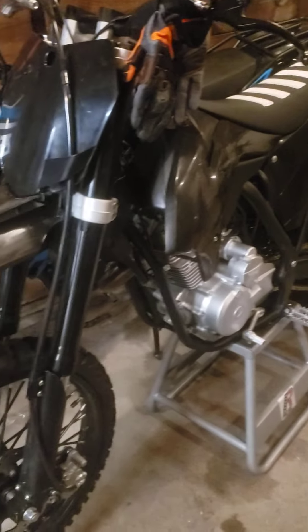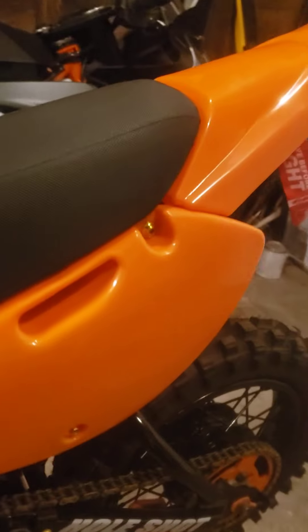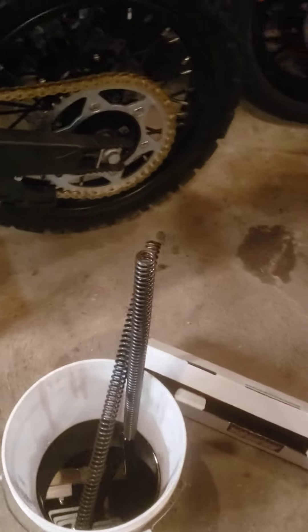Come to find out it's a KTM 105 replica — a copy. I can literally buy 2012 KTM 105 plastics and bolt them right on there. What I'm doing with this one: I got the DMN rear shock, which is totally awesome. You can literally adjust it and it totally changes the way the bike feels. It's a 290-millimeter, 350-pound spring. You do not use the 1,000-pound spring on the stock swing arm — if you get the other swing arm it might work. That shock is awesome, and now with the BBR front springs the bike should feel really leveled. Before, I felt like the front end was lower than the back because the stock springs are so mushy.